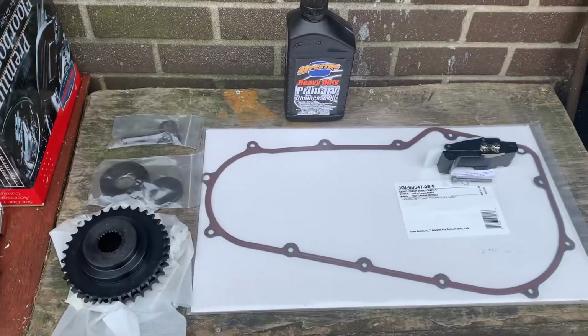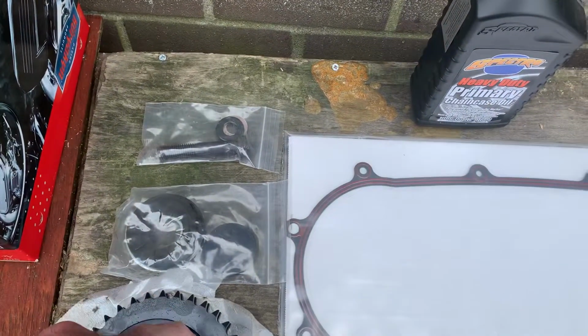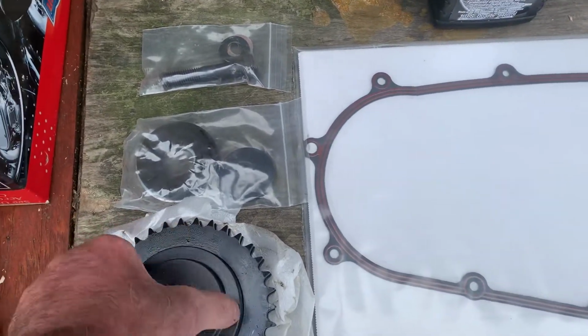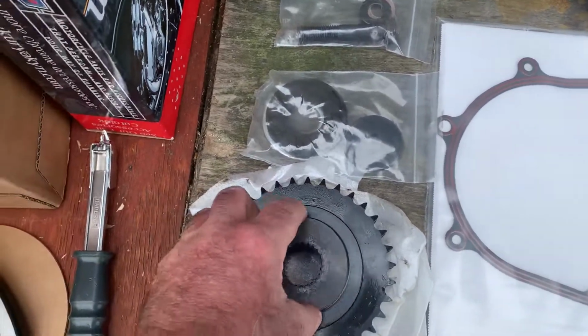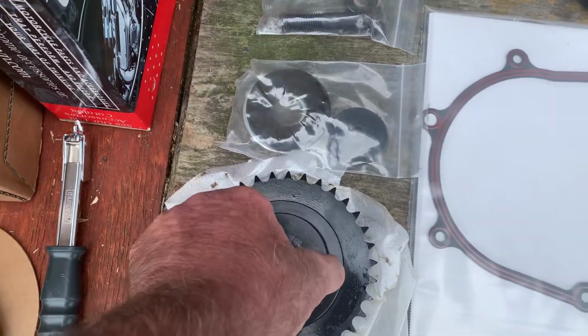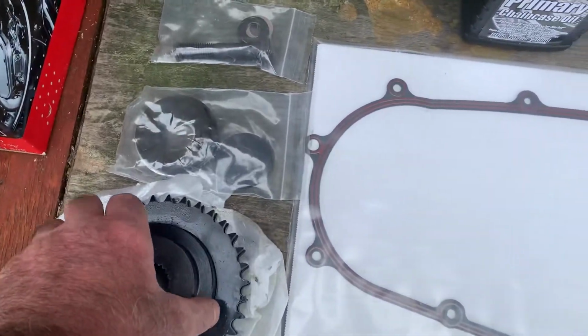Now, the tensioner side of it is very important as well, because the standard compensator, basically this is done with a screw thread. So what happens is, as you accelerate and decelerate, this will take the play out. Okay, so it won't bend all your clutch basket like some of the solid compensators. This is very clever from BDL, Belt Drives Limited.